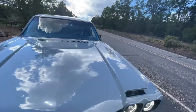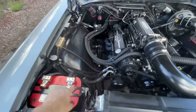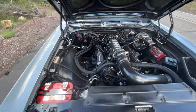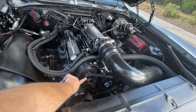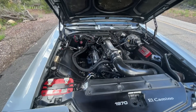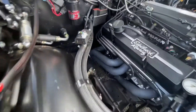So let's take a look underneath the hood here. You can see the AC system is installed. I also upgraded the alternator again when I installed the AC — it was draining power and not working right; the other alternator wasn't working correctly. I also went to a smaller pulley, which allowed me to turn higher voltage, so now I'm consistently in that 13.5-volt range at all RPMs while driving. And then the new product I installed here is on the exhaust pipes.